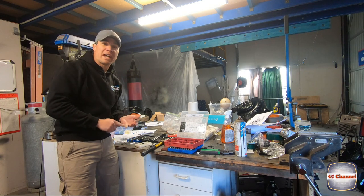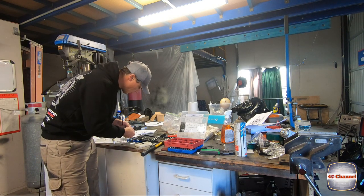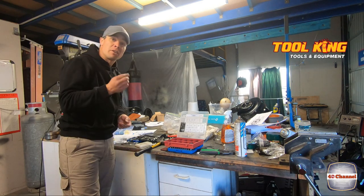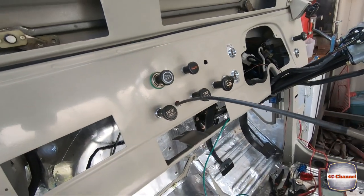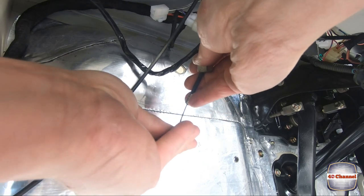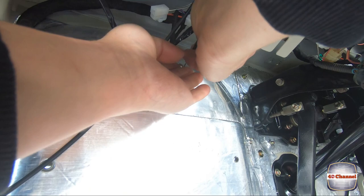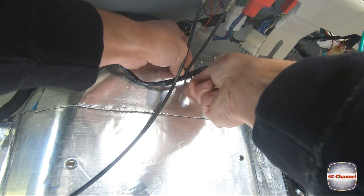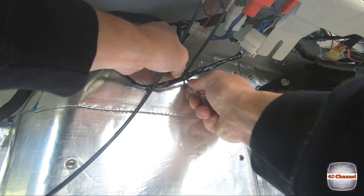As we go through this build, we're putting all our cabling back through and all our wires back through, so it's pretty important that where we can, we try to put rubber grommets all back through. I've just got this rubber grommet kit from Toolking. I've punched a hole through the rubber grommet - we'll be able to slide this, it's actually for the heater tap cable, we'll put it into the firewall. Just slide our nut over first, push this rubber grommet through that hole, then slide it through our main hole and do that 17mm nut up at the back. It's pretty important to try to get these rubber grommets in - it just helps keep any water and dust out of the cruiser.